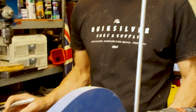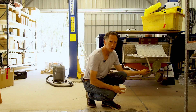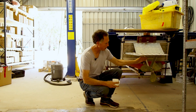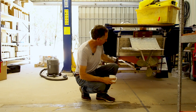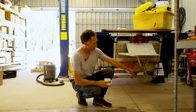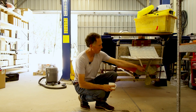And steering. This is all highly theoretical at the moment but we're hoping it's going to work. Now this propeller — I've done a bit of research on the internet — it's what's called a surface drive. People who are boat people will have a laugh because the propeller's not actually a surface drive propeller. But what we're doing is hoping that only as we get the speed up, less and less of the propeller will be in the water, until only the bottom half of the blades is in the water — and that's what's called a surface drive. So it gives you your best kind of thrust.